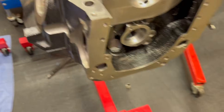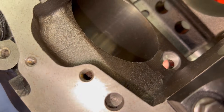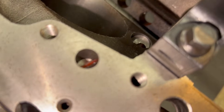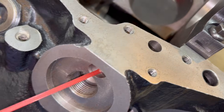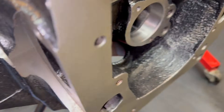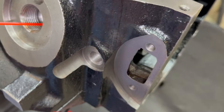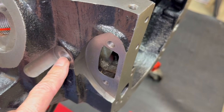Now in this case, look at this — it's the same thing. When you get one of these blocks, you're going to do some massaging, especially when you look through and see what I saw through the oil galleys. I found a wire tie seems to work good so you can see the pathway here until I get the scope out. So the oil is coming down through here, through that hole right there. That oil is going to come back here to the 585, which is this right here. We're going to look in there with the scope and follow up from there. The oil is coming through here into the filter, back through here into the main galley right here.